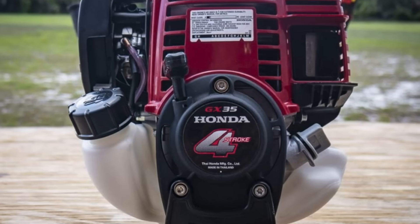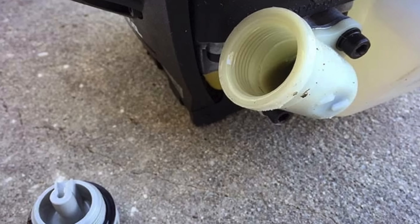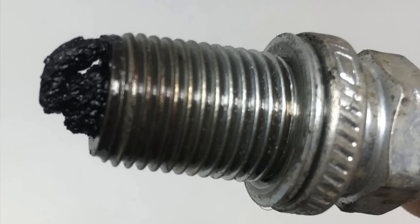There are four-stroke trimmers and augers and stuff like that. I see those smoking in the shop a lot, and that's because customers fill them up with too much oil. When you go to put oil in those, you have to make sure they are sitting flat — a lot of people think you have to turn them up on their side, but absolutely not. Have the gas tank sitting flat, and that's how you fill the oil. When you see it rise up to the bottom of those threads, you've got enough oil. When it comes to two-stroke stuff, there are only a few reasons it could be smoking: you added too much oil to your gas mix — that's not going to hurt it, it just might foul out a plug and clog up your exhaust. Your machine might be adjusted incorrectly to where it's not getting enough air and too much fuel. Or, like the four-strokes, you might have bad rings. But the majority of the time, it's your oil mix or a bad adjustment.